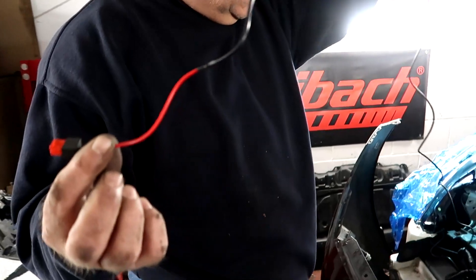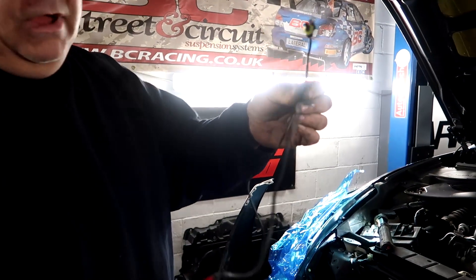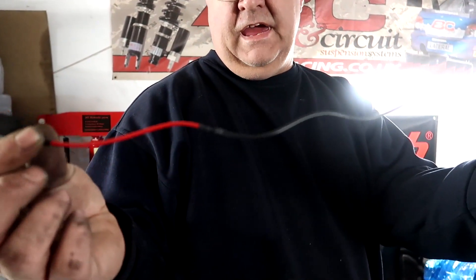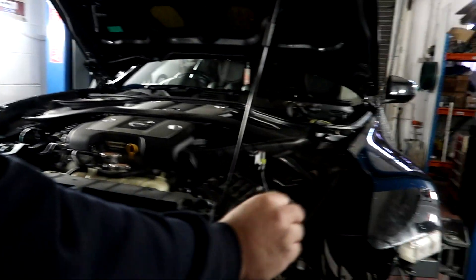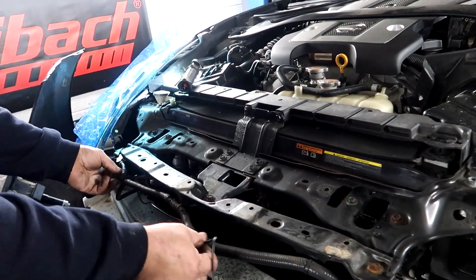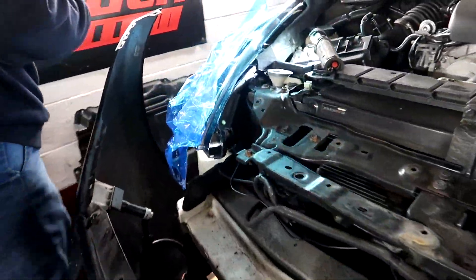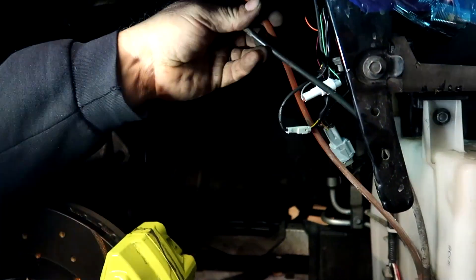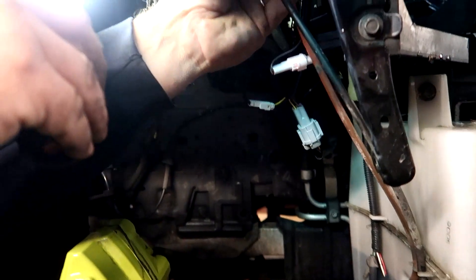You get a little link wire to run from both headlights — this is for the DRL. It looks like it's going to need extending to reach a live feed, but we'll get into that in a bit. Basically I'm running it across the car from headlight bezel to headlight bezel. I'm going to cable tie it once I know we've got enough to reach from one headlight to the other.